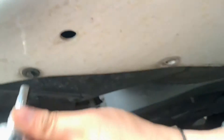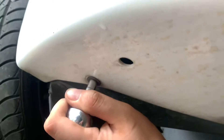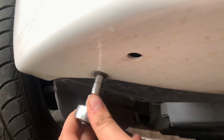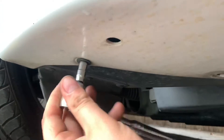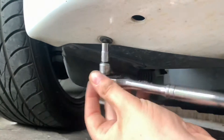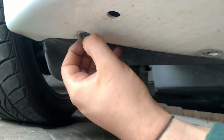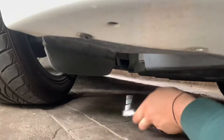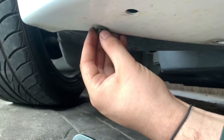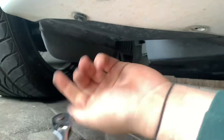After you remove all eight of these bolts — I'll do this last one in front of you just to show you how it goes — then you can pretty much just pull your bumper off slowly. The size again is a seven. Once it's loose enough you can do it with your hands. It's pretty straightforward, just a little bit time-consuming, and it's a one-man job.